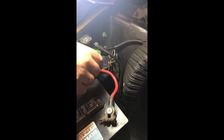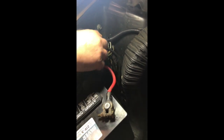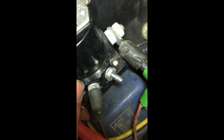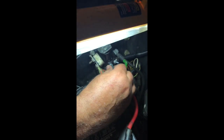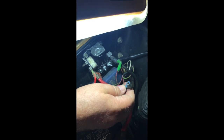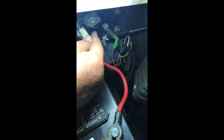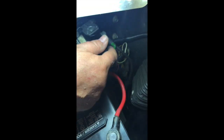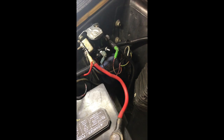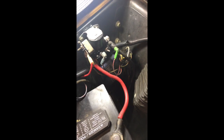The reason I bring it up is I don't want this engine to try to start as I'm trying to crank it over a little at a time — tap, tap, tap. So I'm going to disconnect this terminal, which is marked on a Ford as the I or ignition terminal. You might see a little letter I; over here is a little letter S. I is for ignition, S is for start. When the ignition key is in the start or crank position, it applies voltage here, causing this relay to engage, close the circuit, and send current to the starter motor and out to the ignition coil. So I'm going to use this switch to bump this engine over.